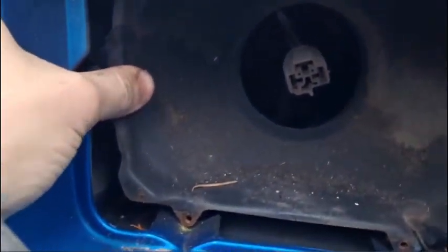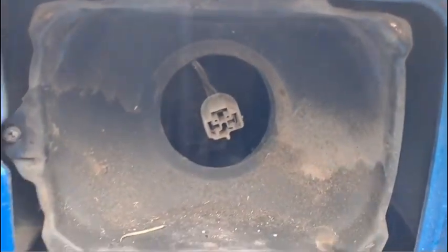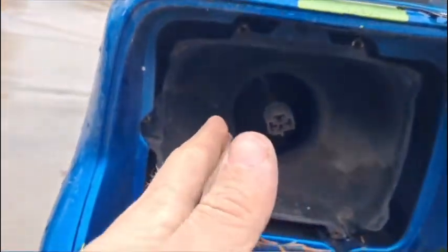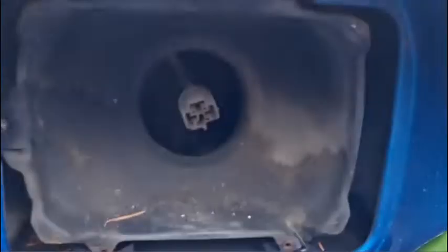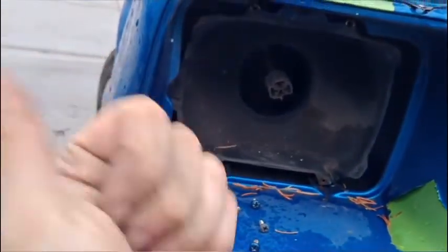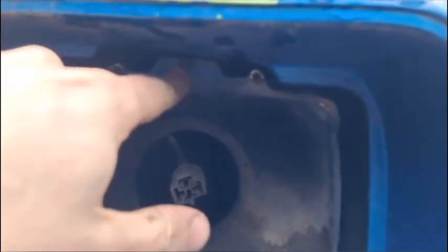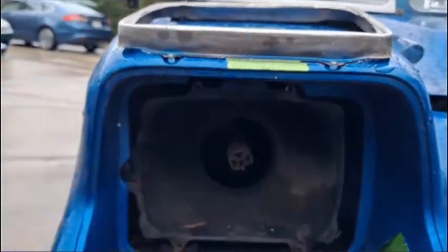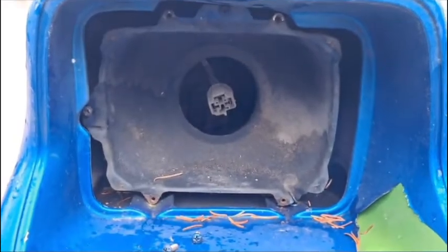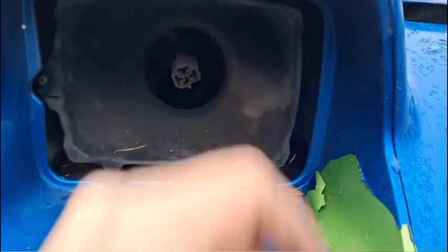Because the housing is mounted somewhat spring-loaded, the side that you tighten down is the direction the headlight will point. So if you tighten down the left side, the headlight will point that way. Loosen it up, the headlight starts pointing the other way. Same with the top — start tightening that down and the headlight points up; loosen it out and the headlight points down. After that, it's really easy to adjust to your liking. I might have a video on that in the future, but it's very intuitive and anyone can do it.